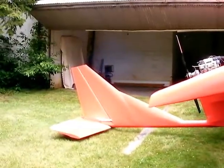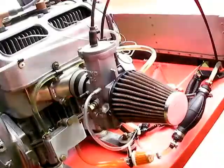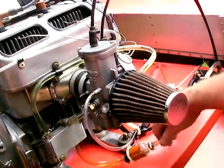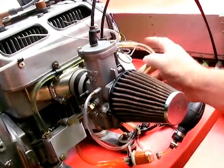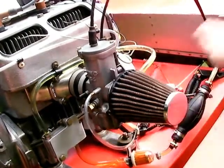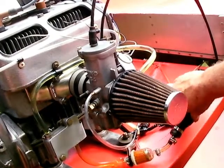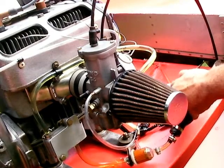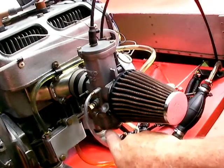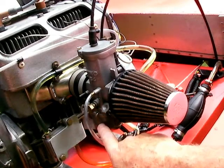Next thing I'll show you: if it's been sitting a long time, especially in a hot hangar, a lot of the fuel is going to turn to vapor and you'll get air bubbles. And if it was shut off warm, probably the fuel in the carburetor bowl will percolate out. So to fill it, it has one of these little squeeze bulbs — it's what they use for an outboard motor. You squeeze that and it will pressurize and pump fuel into the carburetor if the float bowl is empty. Sometimes if it's sat for a long time, you might need to do that to get it to start when it's cold.